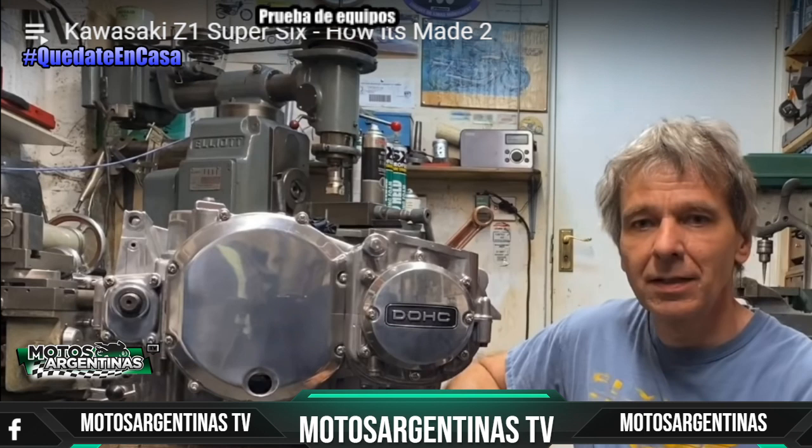Once the sprocket cover was all clean, I went out in my shed, found a little sheet of aluminium, and cut out a piece that I'm going to weld onto the sprocket cover to extend it by about 2 inches. So I cut out a rough rectangle at this stage, because I'll be taking it back into the garage, bending it and then welding it to the cover.